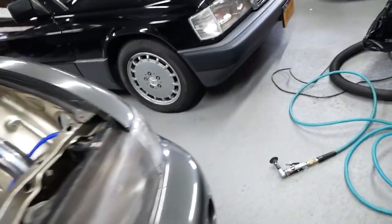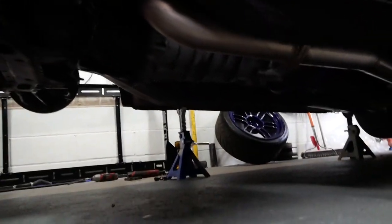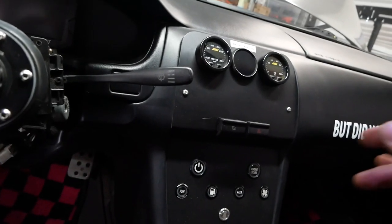So the purple wire now goes from a starter bolt straight to the frame. I also spray painted around it just to help prevent rust a little bit. A little restless waiting for parts from Amazon — they're prioritizing essential stuff so the wire ring connectors aren't shipping until Friday. I might have something floating around to make a makeshift ring, but it's not that important right now. When the connectors do come, I'm still going to run a ground from the battery all the way up front to either the engine block or the frame rail.